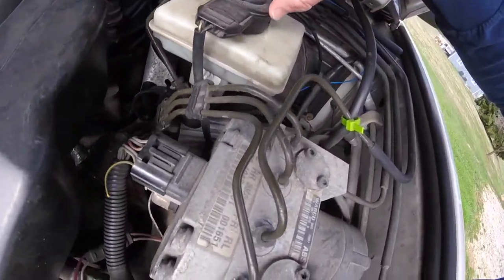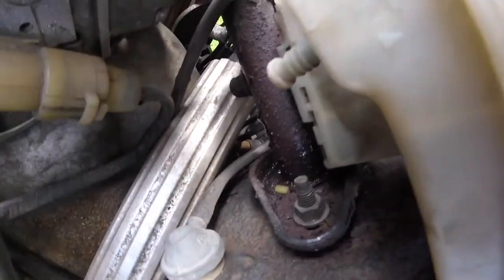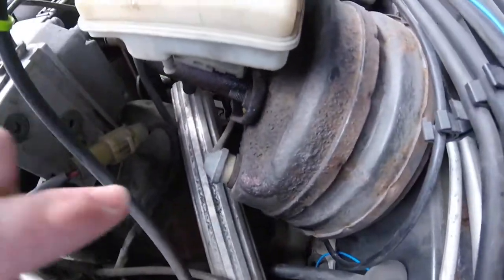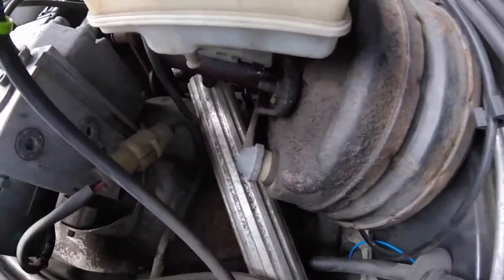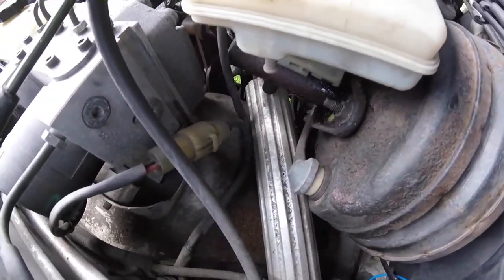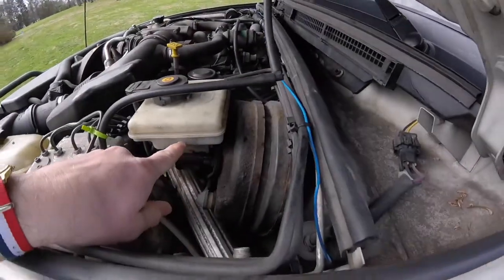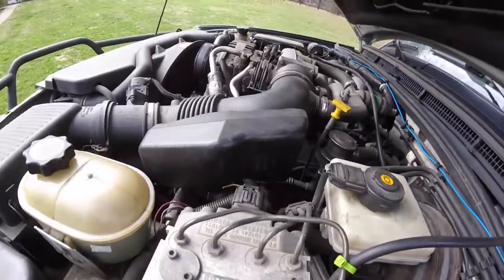You can see how it's wobbly — that's obviously where I'm leaking from. Getting in closer, you can see the brake fluid on this side and how it's caked up on here. There are little seals underneath that I need to replace. Let me get set up, drain what's left of the fluid, and show you the parts I got.